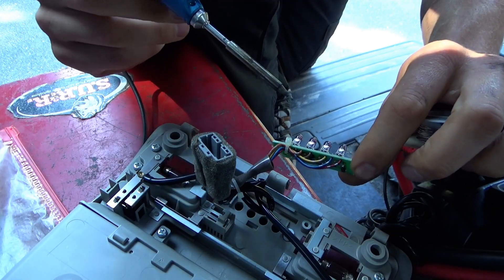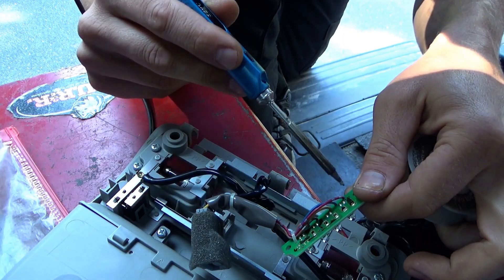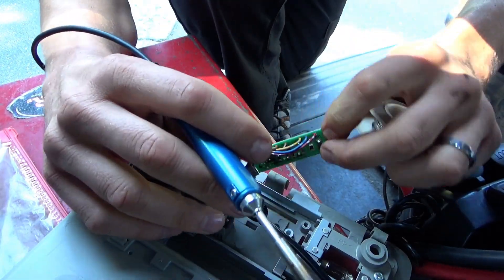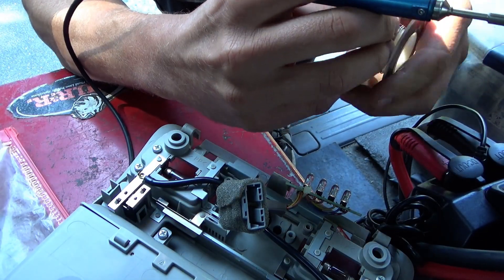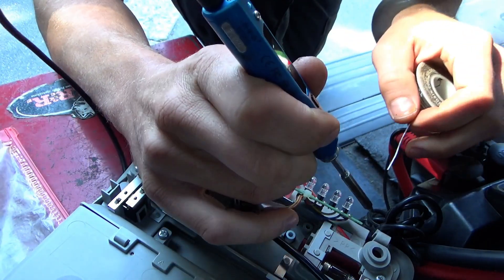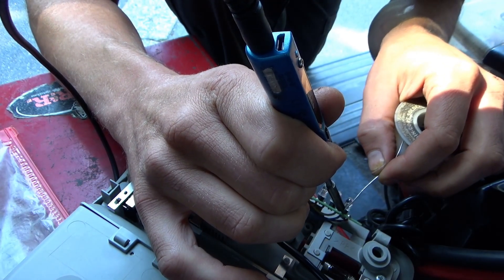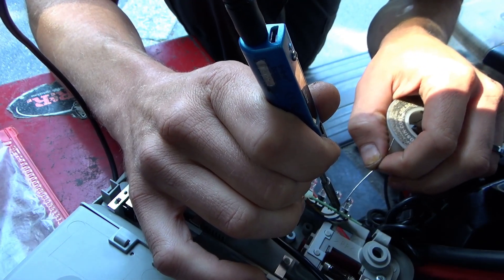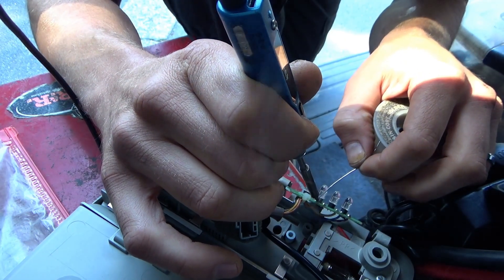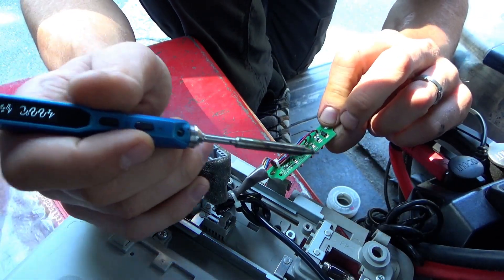So you can see there are five wires, so you want to re-solder joints 1, 2, 3, 4, 5 here. And then the LEDs, 1 through 8. There are some resistors on the back — usually those don't go bad. So we'll start with the wires and see if that fixes the issue. We'll pre-tin and go to town — we're going to make these joints better than factory. Northridge Fix would be proud, except we're not using flux because the solder is flux core. So those four are done, quick and easy.